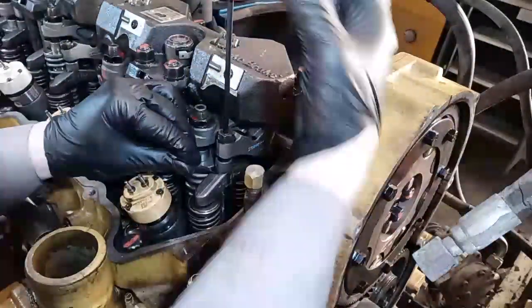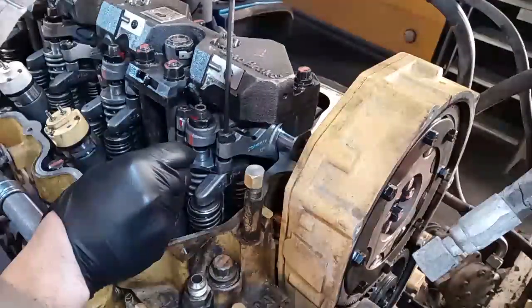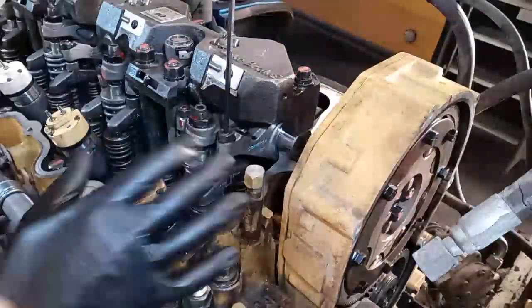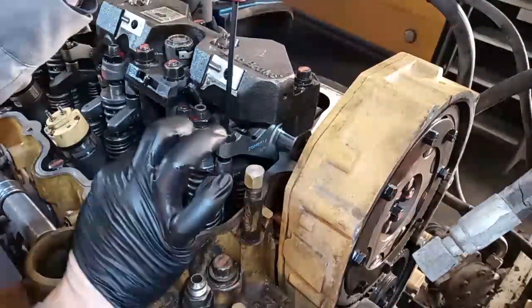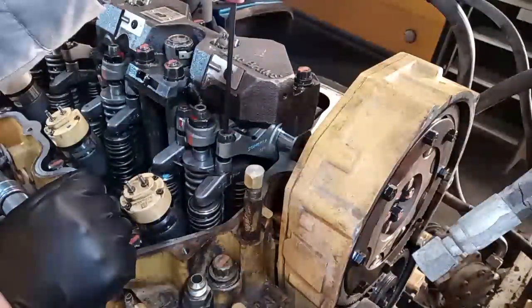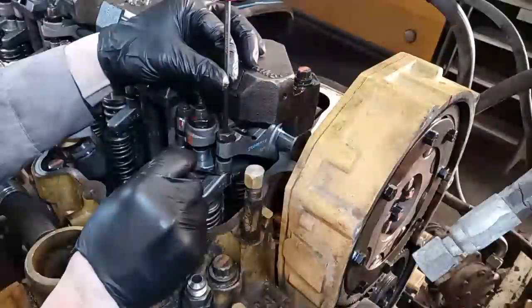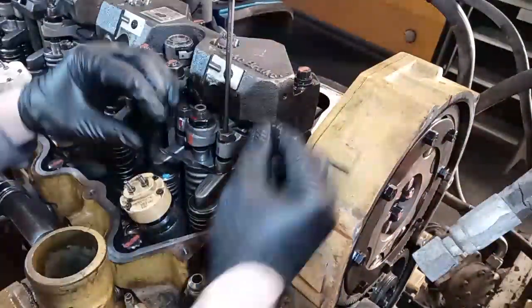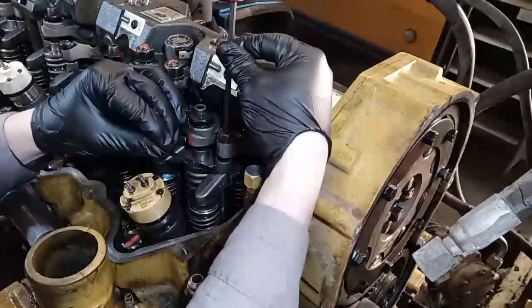Watch — it's going to go fast. We have the feeler gauge under the rocker arm. We're going to go until it's basically a light drag, then go a full rotation past that so it's actually starting to push the valves down. This keeps the feeler gauge super tight and squishes out any oil or residue between the valves, camshaft, and rocker arm. Then we back it off until it's loose, and go finger tight.